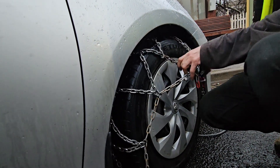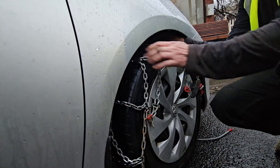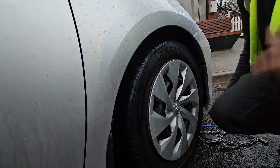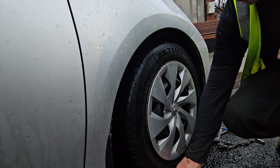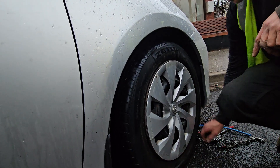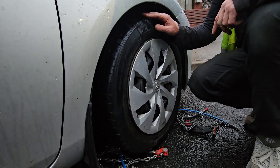Pull the chain towards you — the locking device will come to the back and to the top of the wheel. Reach in and straighten that chain up, then release. Now as soon as you drive on snow chains, part of the chain's going to get stuck underneath the tyre and the ground, so we can't pull the chain out directly. Make sure the red ratchet and the black torsion box are out of the way, then drive off the chains.